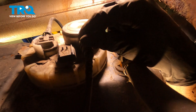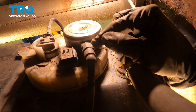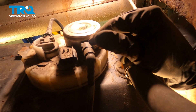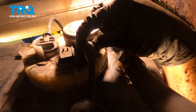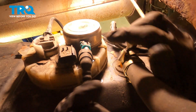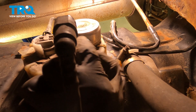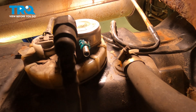Just to the rear of that, you'll find your fuel line. It has two locking tabs, one on either side of it. You want to squeeze those in and then you should be able to draw the line off. Sometimes you have to use pliers for this or you could just use your fingers — it really depends on what works best for you. This blue locking tab will come off of this, but we'll do it once we get it down where we can see it a little easier.